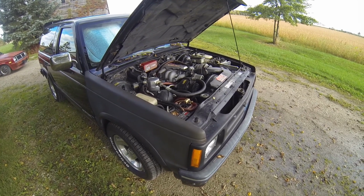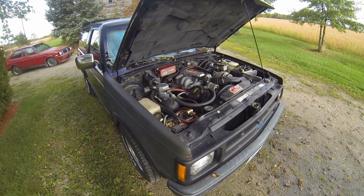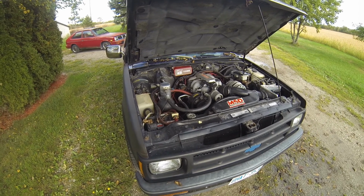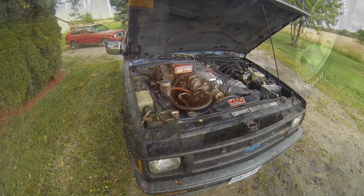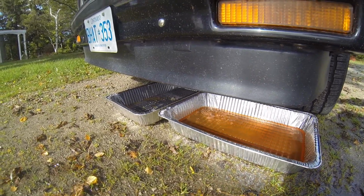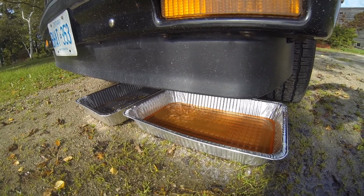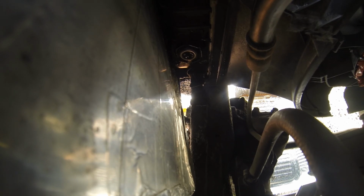And what I found is the spout on the radiator on the driver's side at the top has a split in it. It's not in a spot that can be repaired, so I ordered a new radiator. So now I'm going to drain the coolant, I'm going to catch it, recycle it, I'm going to flush out the engine, try to get all the remnants of the old coolant out of there. And then I'm going to put my new rad in and I'm going to refill the system, and let's hope that everything after that will be alright.